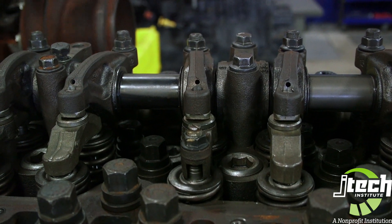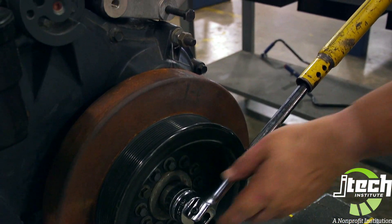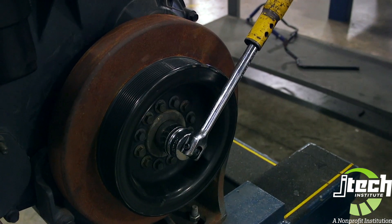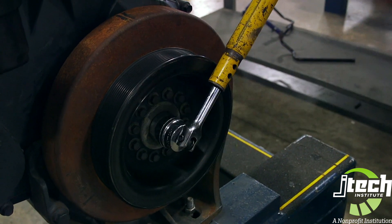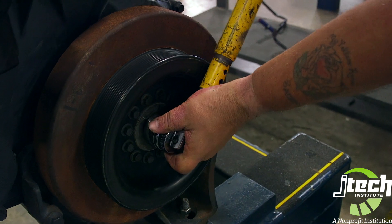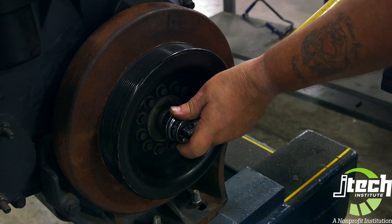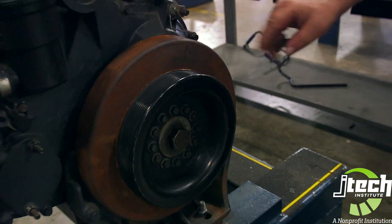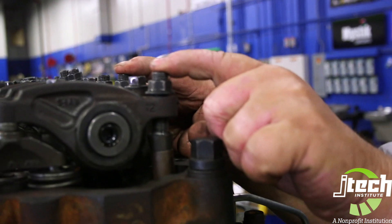At this time we will start and we'll have to re-rotate the engine 360 degrees. Put it on the engine, come around to this side. We're going to come all the way around 360 degrees and come right back to our timing mark. Remember folks, these are diesel engines and they don't turn that easy — a lot of compression on these engines. They run about 22 to 1 compression ratios. So now we're back on our timing mark again. We'll go to the back of the engine and check our push rods — they both turn freely. This cylinder is now on top dead center.